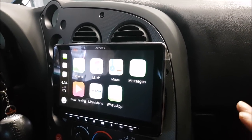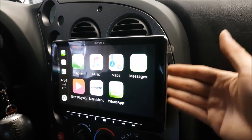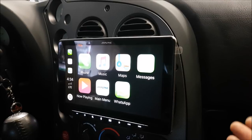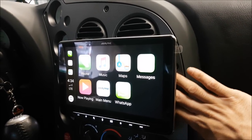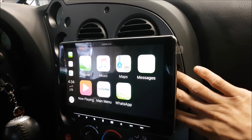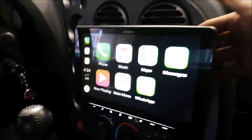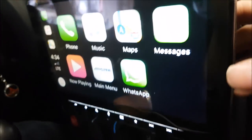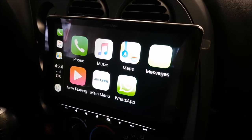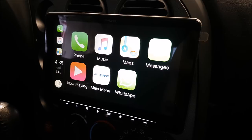For the installation itself it was pretty straightforward. The reason I used those ISO brackets is because I need to be able to service this and want to be able to take it in and out within reason. If you use a traditional cage you can lock it in, however it'd be incredibly hard to get your keys in there, and the way this kit is you can't get at the screws easily to take it out. So we have to keep serviceability in mind, but for the most part it goes in like an aftermarket head unit.